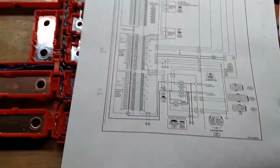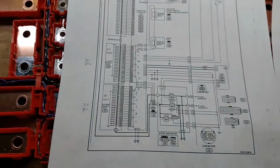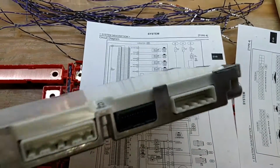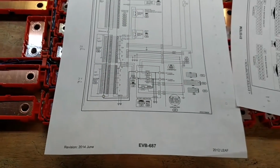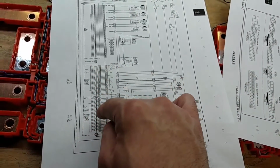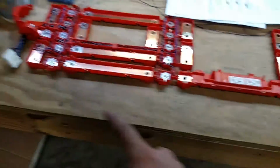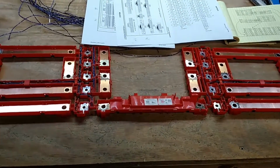But anyways, you'll see this is the wiring for these two connectors, that's this one and this one. But these are the actual wiring for the BMS unit, which I happen to have sitting right here. So there's actually another cable that translates that and plugs into these two connectors, because those don't directly plug in, and these are not a one-to-one mapping for the pinouts. But I have those cables because they were used on both. This cable does exist that connects the left-hand and right-hand packs to the BMS. So I'm going to definitely use that, because you can see I ended up with these at opposite ends, and so those two cables will allow me to bring both those together and then plug in the BMS somewhere in the middle. So that should work out pretty well.